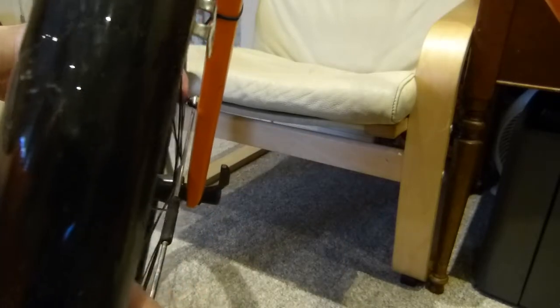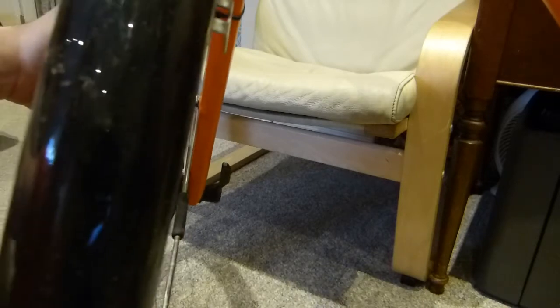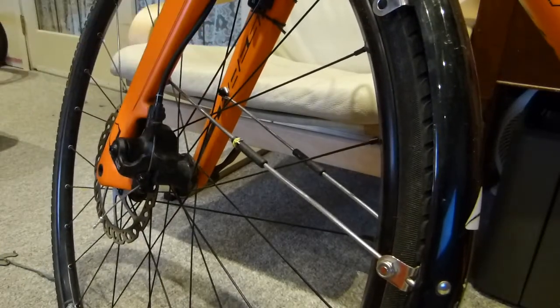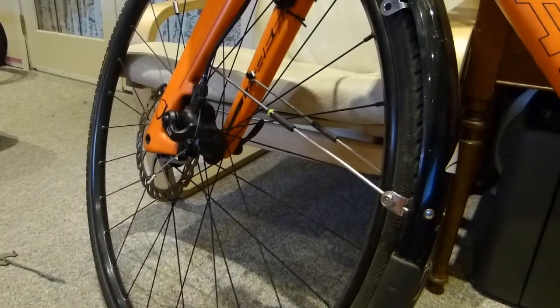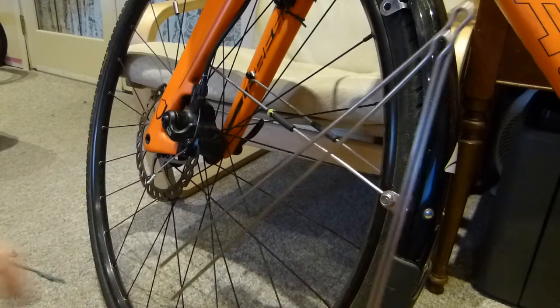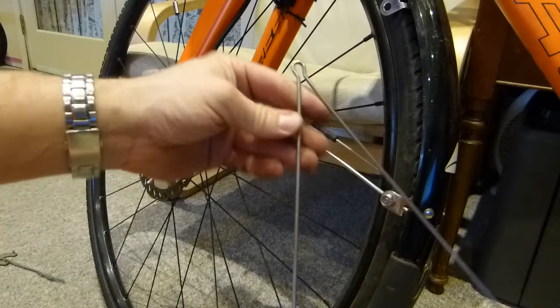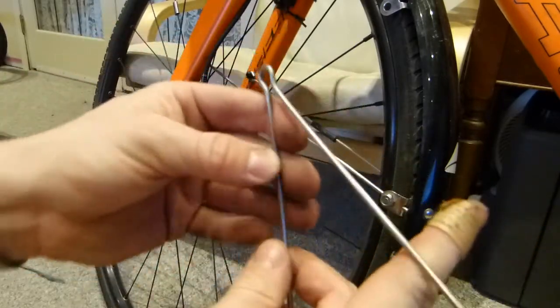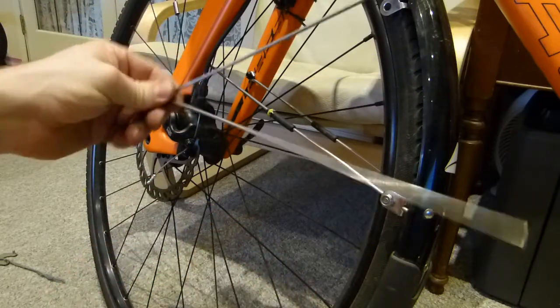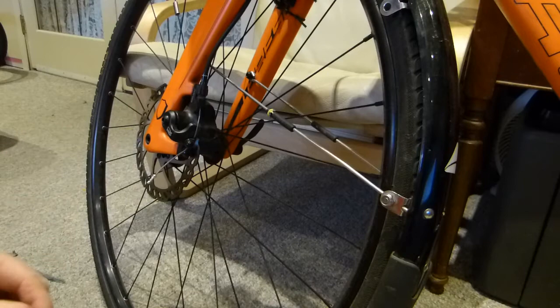So if there was a second set of wire stays, one placed on top of another, the bolt head would be closer to the spokes and there really wouldn't be enough clearance. A third wire stay could therefore be placed on one side, but not a fourth one on the other side. The solution is a different wire stay not included with Axiom's supplied wire stays. I need a two-in-one - something like this shape where two wire stays are on one loop. It's not doubling up the thickness, so clearance is not an issue. These are not included in Axiom's Roadrunner fenders or any model of Axiom's fenders.